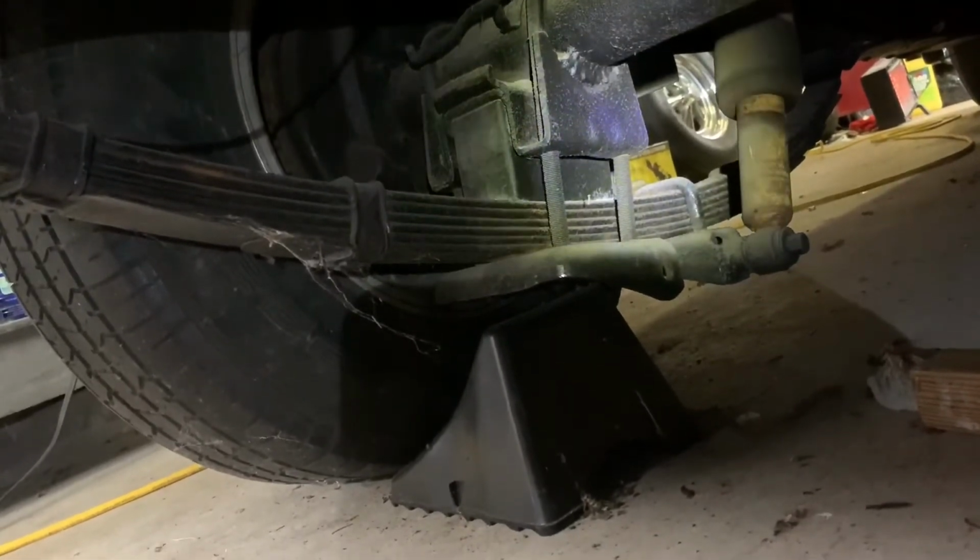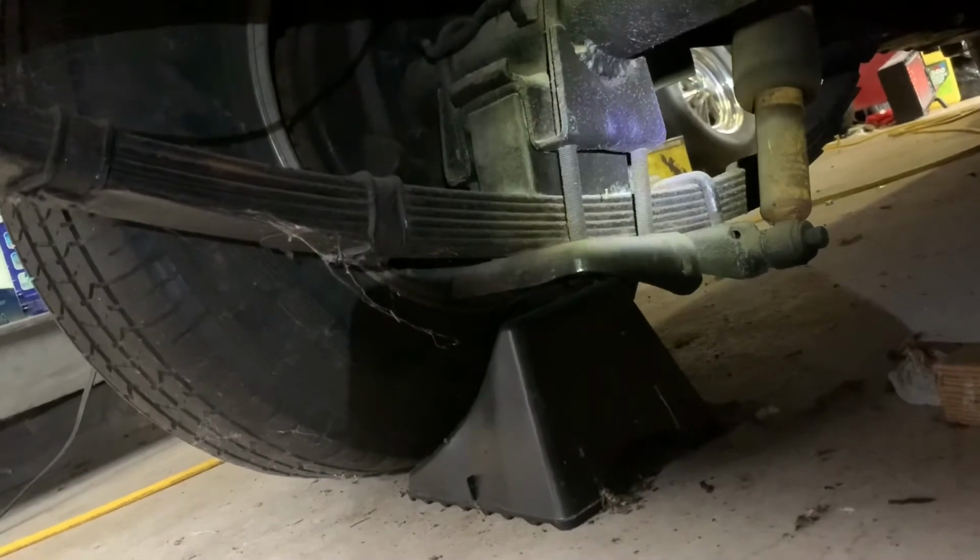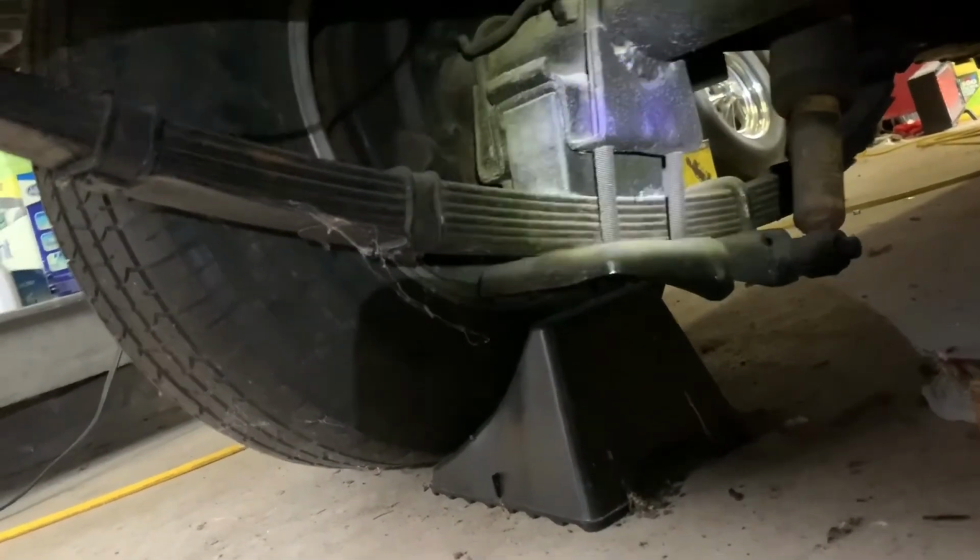Oh, those guys did me a favor and they welded those U-bolt brackets to the rear end. So I can't even adjust those. The pinion angle on the rear end, from what I can see from here, looks good. I have to investigate some on that too. So I know I'm not going to leave the shocks like that. One way or the other, they got to get moved back. So I'll have to get new shocks, if I'm sure those won't reach.